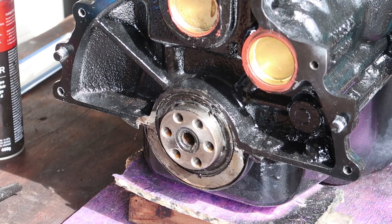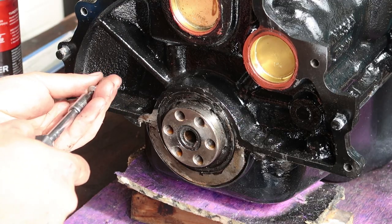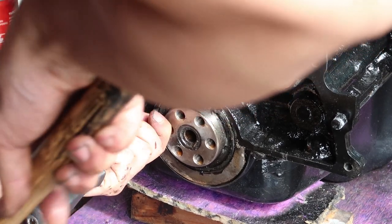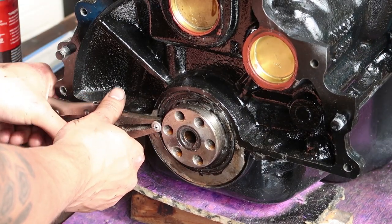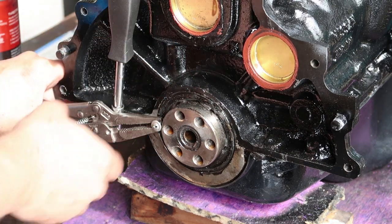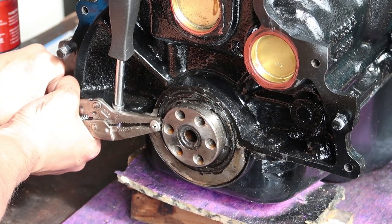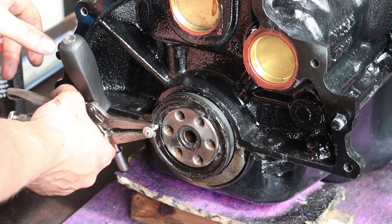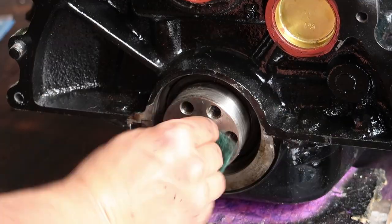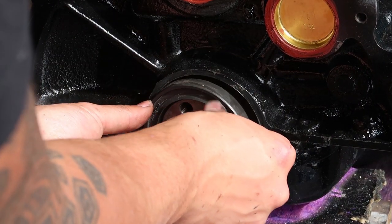Moving on to the receiving end, time to switch out the rear main seal. I initially had a bit of trouble getting this out as I didn't have the specific tool, but what ended up working for me was to drive a screw through the seal and lever it out with vice grips. I know there's a metal ring on the inside I could grab onto, I just had to note the length of the screw and the thickness of the seal to make sure I didn't penetrate too deep and scratch the metal behind or beside.